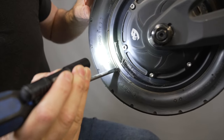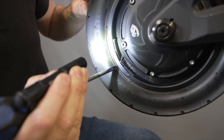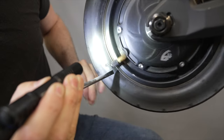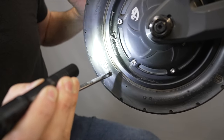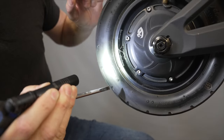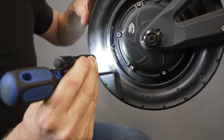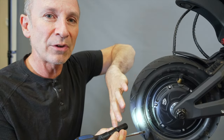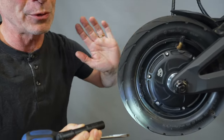The way you check for that is to look at the small line on the tire and how it sits relative to the wheel. If it's even all the way around like this one is, then your tire is fully seated and it's as good as it's going to get in terms of how round the tire is. If this line has sucked down underneath the rim, you might be able to fix that by letting the air out and reseating the bead — and that's the subject for another video.